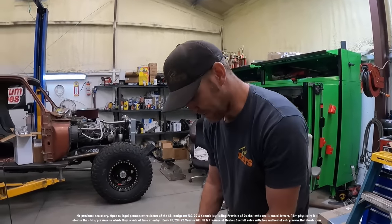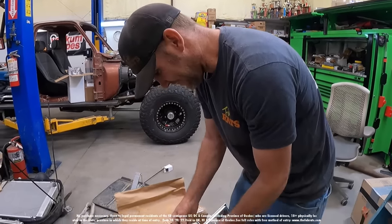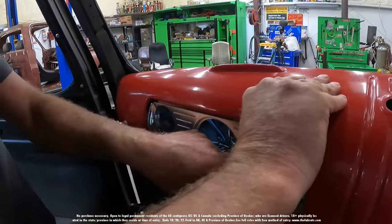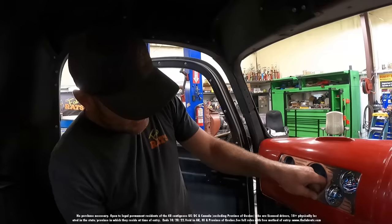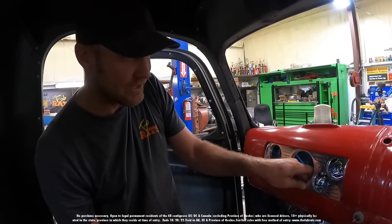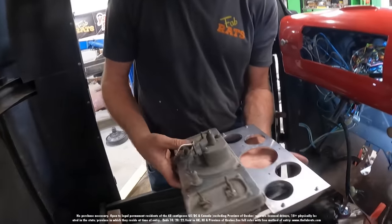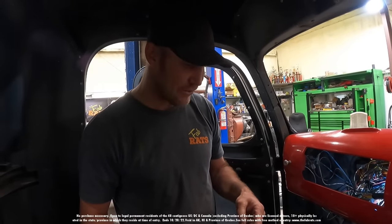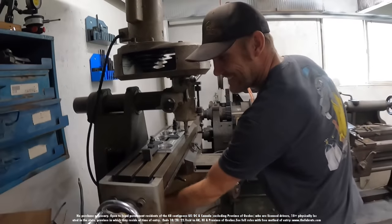You just watched me put all these gauges in — now I'm tearing them back out because I spent good money on quality parts that don't fit. If I put it up where it's supposed to go — nice, flush, flat — it won't fit in the dash. The bottom edge needs to be milled off so it'll fit. And there's nowhere to mount it — no original mounting tabs. I thought this would bolt in and take 29 seconds; now we're going to be hours into fixing it.